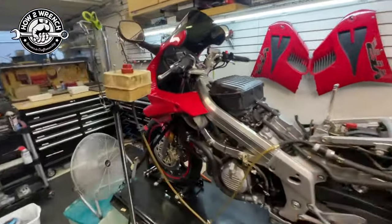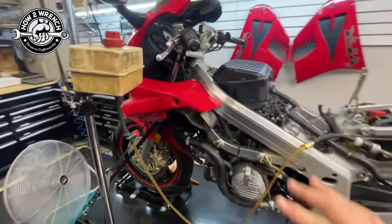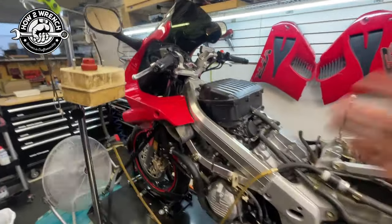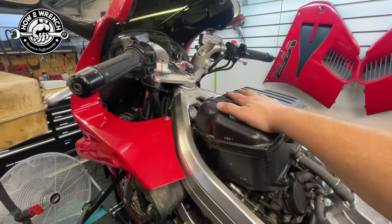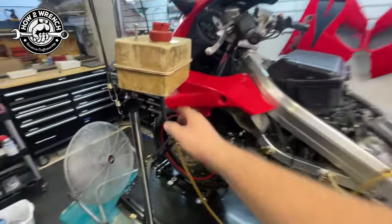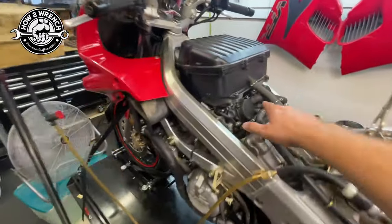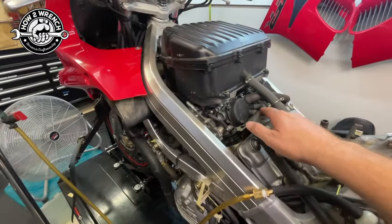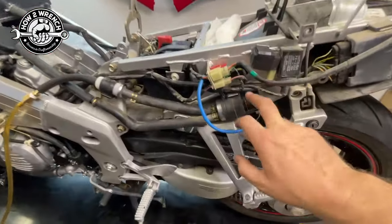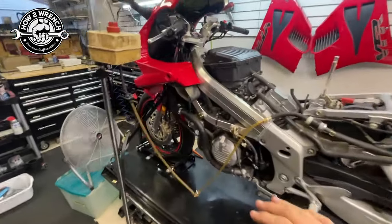So this is my point — it's cool to do tricks and make these stopping points, but make sure you don't burn yourself thinking something's wrong when it isn't. Typically when I don't run the airbox or the fuel tank and I'm running my own fuel supply, I'm always starting it right at the carburetors themselves — I'm not even dealing with the fuel pump or anything else.